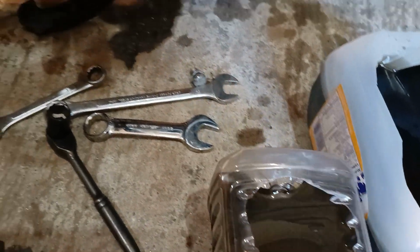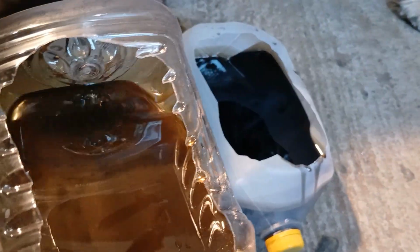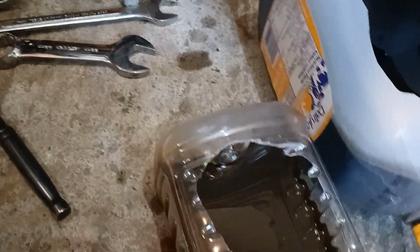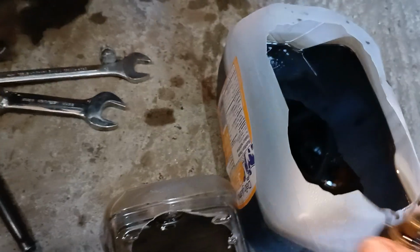The gearbox oil again is discolored, but not as bad as last time. If you tip it, there were no particles catching on those ribs. And so yeah, a little discolored. It looks browner on the camera than it does in real life. It looks just like normal gear oil that you drain out. Now then, the plug on the engine is clean. There's nothing showing on there. The plug on the gearbox is obviously not showing anything.